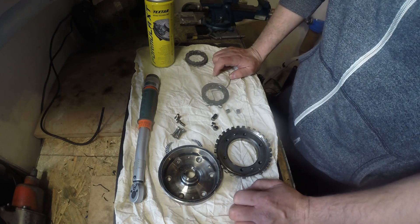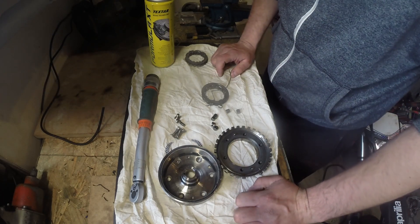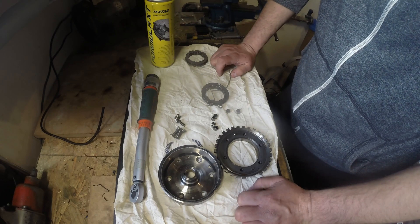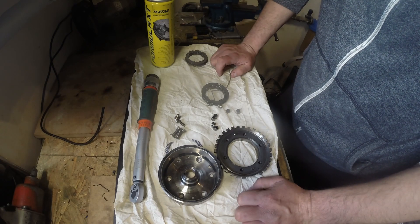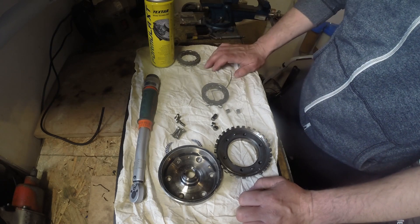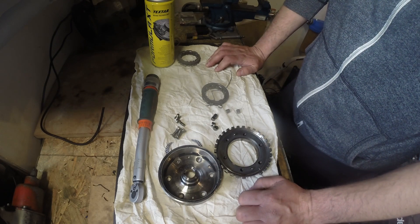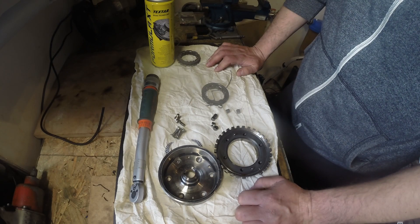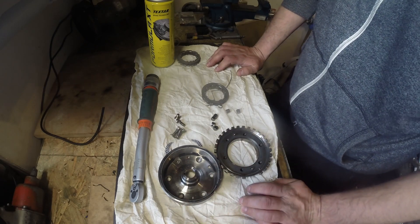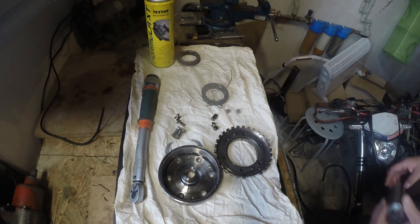Here is an example from my bike. It has right now about 110 hours. I had problems with starting — it was random. Sometimes it started okay, sometimes there were some strange noises from the starter area. So as I checked the starter, it is fine. So I had to take down the magneto with the flywheel — actually the flywheel, which is the magneto here. To do that I had to use a special tool like this.